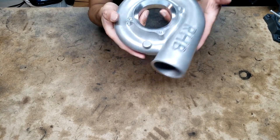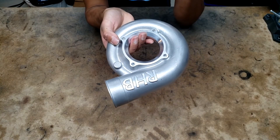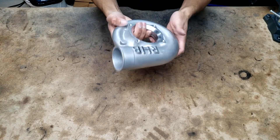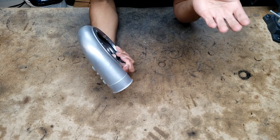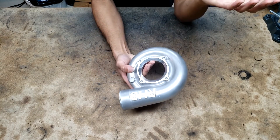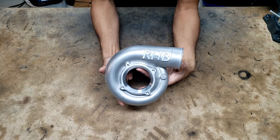This is one of the few compressor housings in the world that are 3D printed. Formula One actually makes them this way — they use all the capability of 3D printing, weird shaped outlets, and actually have two outlets on the compressor housing because of their hot-V setup. Each car has a slightly different setup, so it makes more sense for them to 3D print it. Maybe some other turbo manufacturers do this for prototypes, but no one's really vocal about that.